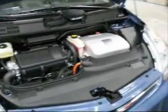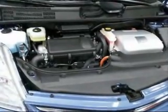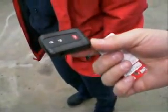So if you came up to someone incapacitated at an intersection — a drunk that fell asleep, someone who had a heart attack — and they were not able to secure the vehicle, our biggest danger is this vehicle could actually be on right now and you wouldn't know it. It would just be dead silent. In moving a patient, you might accidentally hit the accelerator. So chalking this vehicle is very important, turning the vehicle off is very important. And because it has a smart key that just needs to be in proximity to work, you want to get that key about 25 feet away from the vehicle as a safety buffer.